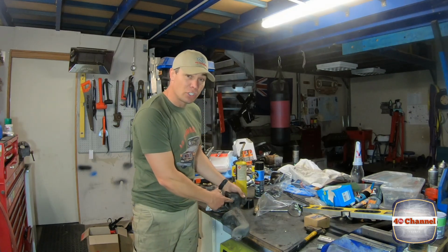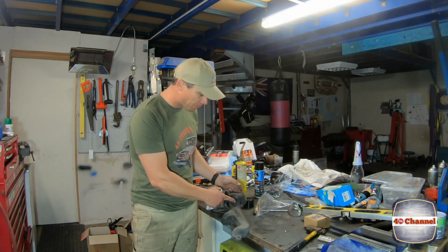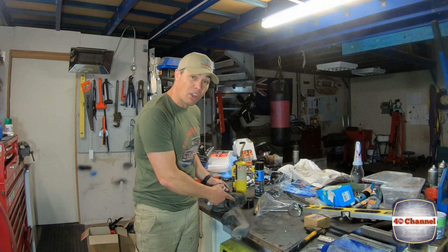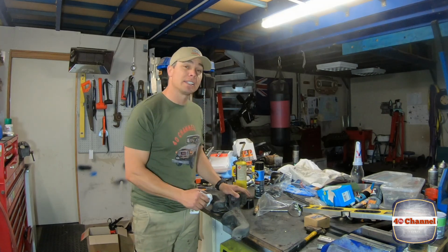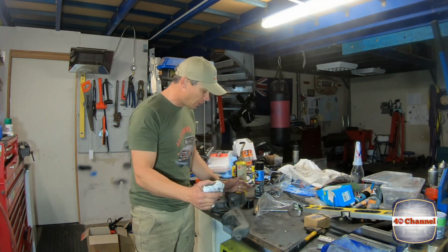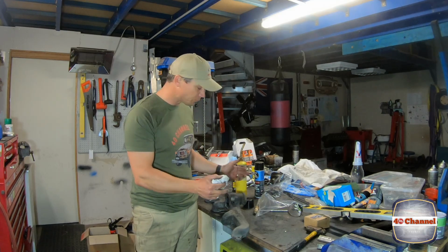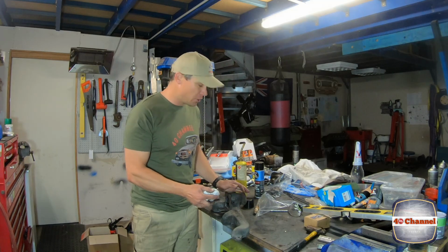Now I'm just gonna clean out the two little holes where that shaft went through just with a die grinder, and then we'll weld them up. Now we're only just gonna put just a light weld over the top. That'll seal it, stop any exhaust coming out. But what it does is that if I need to go back and put something in there, I can just re-drill those holes out and we can put something back in there if we need to in the future.